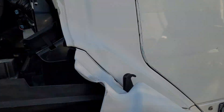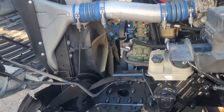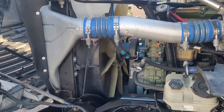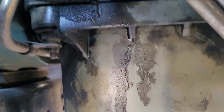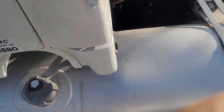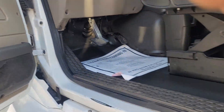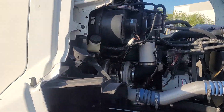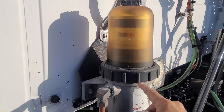As you can see, there's no blow-by out of the oil fill tube and no blow-by coming from underneath. Now this is the truck with the seeping oil, so I'll go to the oil pan to see if there's any fresh oil coming out. As you can see, it is a very, very slow oil seepage. The only downside to these trucks is the key doesn't come out. Auto shut-off – I didn't rev this engine and it shut off. You can see there's no restriction in the fuel filter or fuel lines.